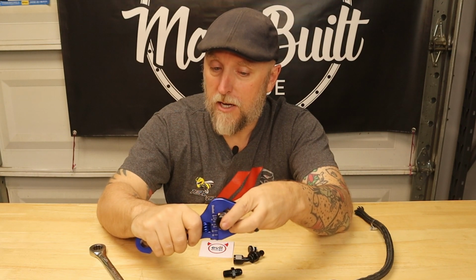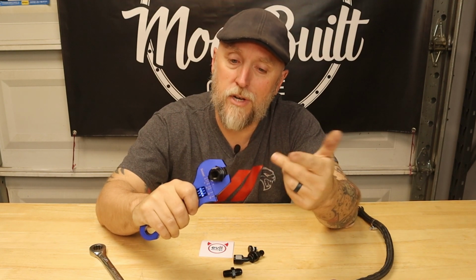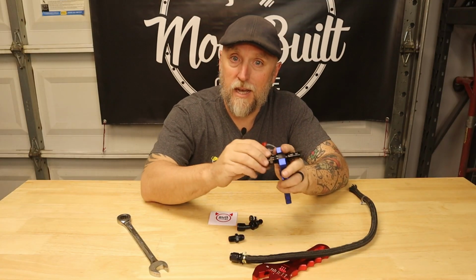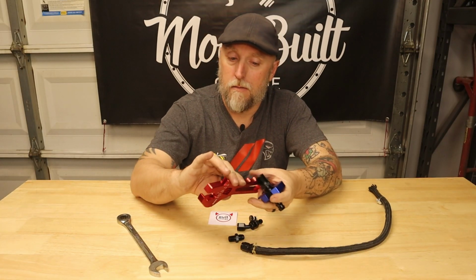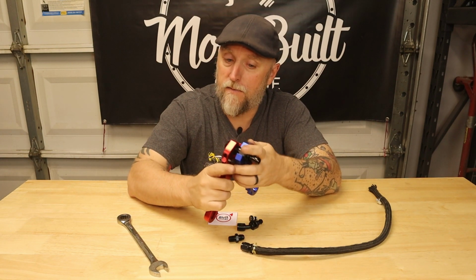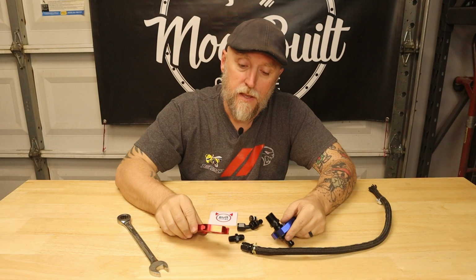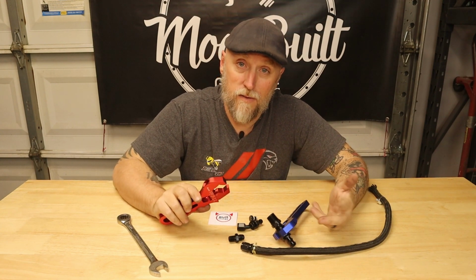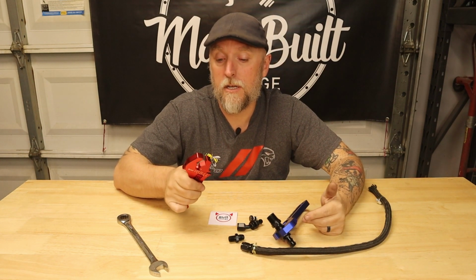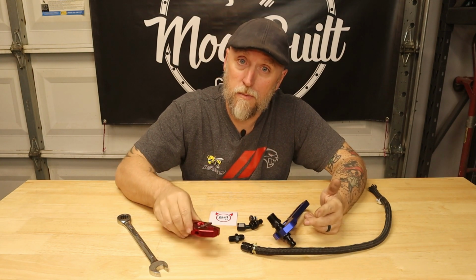What I like about having the adjustable wrenches, again, is the fact that I don't have to have 2 8s and 2 6s and 2 4s for assembling lines. I mean, 2 wrenches, and I can do any AN fitting. Get on there, and then I can immediately go right from this to a -6. It just means I don't have to own or invest as much money into a set or 2 sets of AN wrenches. Guess it all depends. I could see owning both kinds.